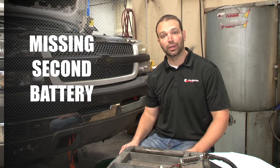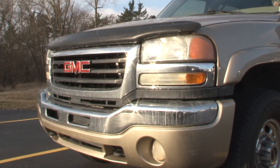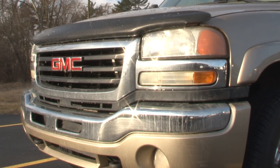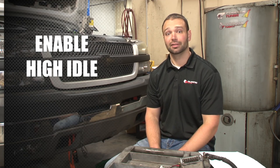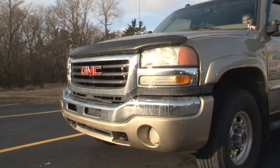You really want to have two batteries in the winter. A lot of these trucks came optional with high idle, or it's a feature you can enable through the systems menu. A lot of these trucks will idle up to 1100 RPM, which is really nice. They also use the variable geometry turbochargers to maintain heat in the engine. Google high idle and your RPO code and you'll probably find instructions on how to do it.